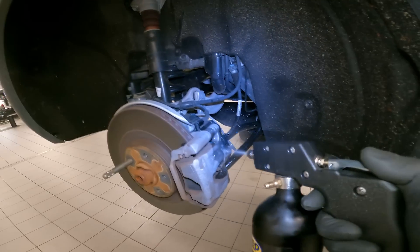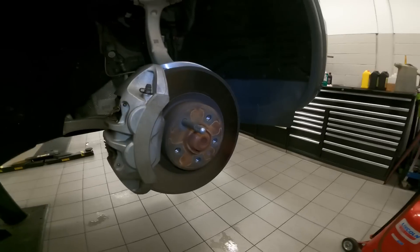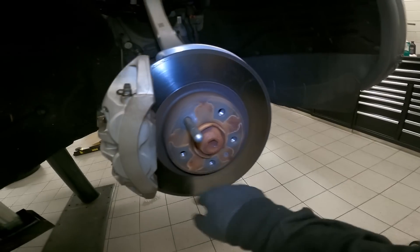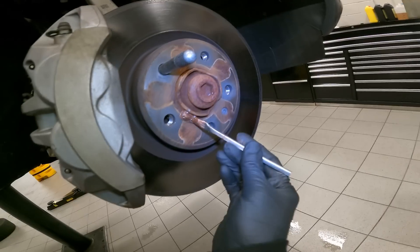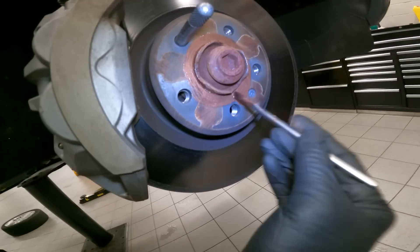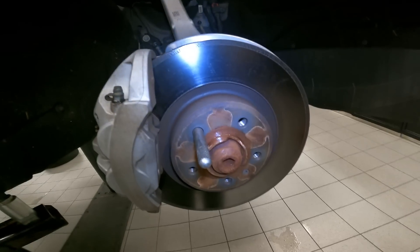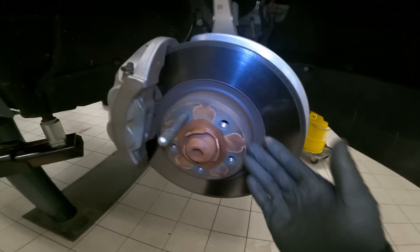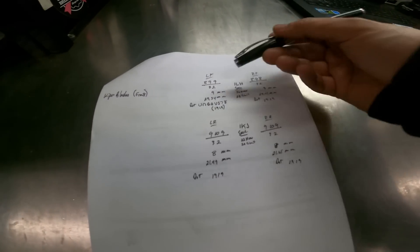When you're done with your brake fluid exchange, always clean your area — make it look like you were never there. Before I put the rim back on, I brake-clean the caliper of any excess brake fluid, wire brush the hub, and put a little bit of high-temp anti-seize on the hub. Remember, there are no mistakes, only happy little accidents — just put a little bit, not a lot. You don't cake it on to the point where it bleeds onto the rotor face. That way, if the customer gets a flat, they won't struggle to get the rim off.